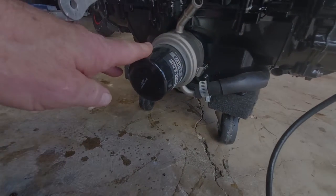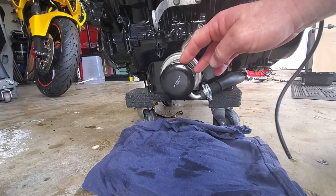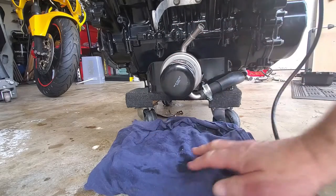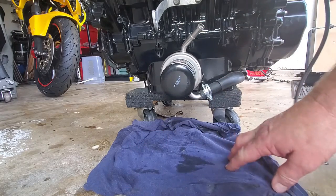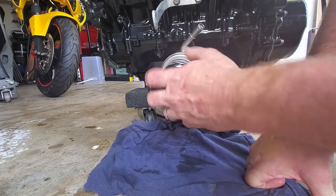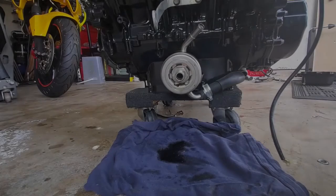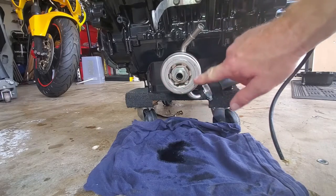Even though the oil is drained, I do believe there's going to be a little bit of oil dripping out of this oil filter, so I've just got an already oily shirt down here. I don't expect it to be a gushing spout of oil or anything. I've already loosened this — we're just going to take this oil filter off and set it aside if it looks good enough. Now we're going to take the actual oil cooler off, so we've got the filter off.